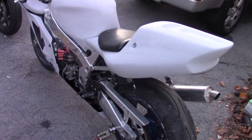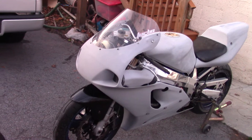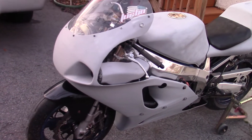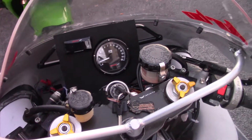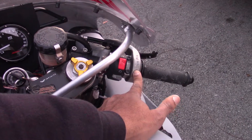Check out these classic super bikes. First up is this Fire Breathing Dragon 1998 779cc Wiseco piston kit, Webcams camshafts race grind, ceramic transmission bearings, ceramic cam bearings. I did a polish on the exhaust ports. We're running a Kibble White top end kit. We got the race airbox from Airtek, got the Sharkskins bodywork. Over here we're running a Koso tach that was wired up, a Koso temperature gauge — I'm actually waiting for a replacement because I accidentally damaged the wire on this one. No biggie. All the bodywork's been primered. Removed some of the stock components — that choke switch and all of that. I got a rigged up ZX-14 switch to save some space, a custom Motion Pro revolver throttle, first gen for ZX-10.